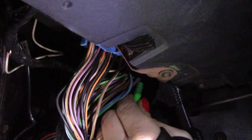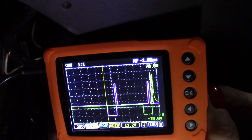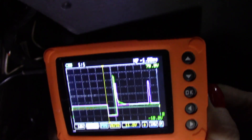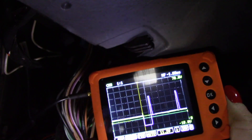And I'm going to switch it back to the other one just to prove there's a huge difference. Back to the green injector. It's really hard to see under here, but there we go — back in. Check that out — go ahead and snap it. Check out the difference. So now you have known good, known bad. And there's a quick and dirty on using a scope and how useful it is on diagnosing intermittent problems.